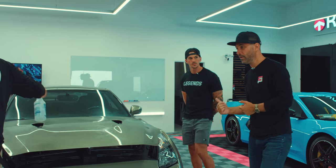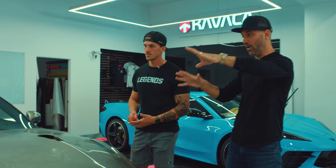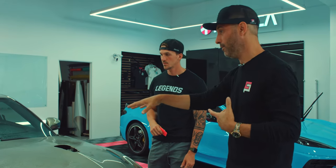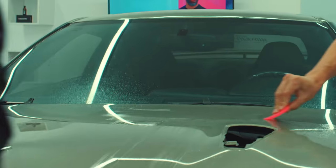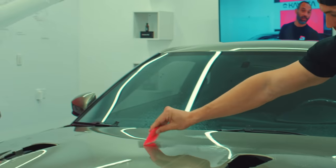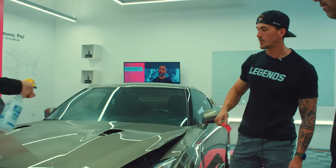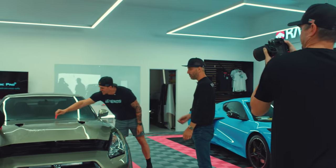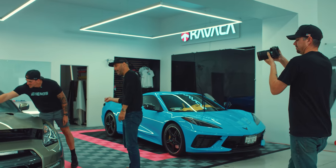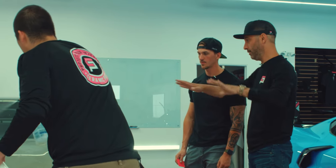All right, so we're going to have you hop in and take out the extra squeegees. Brandon just basically put more slip solution on there. He's holding the rolled-up film. Our objective right now is to get no dust on the surface. Then you just squeegee it off with overlapping strokes — start from here, move this way. Don't wipe it on your shirt or a towel. The idea of the slip solution is that the film will basically be able to float.